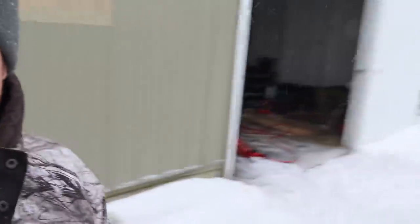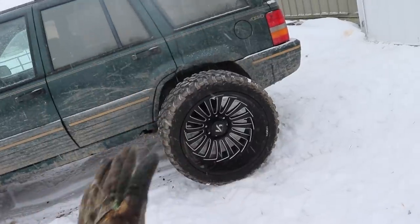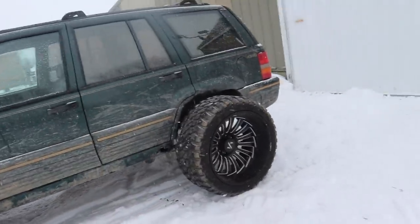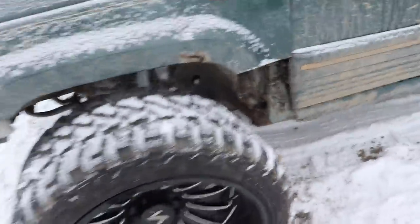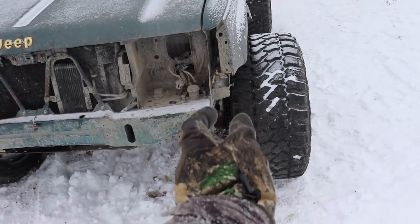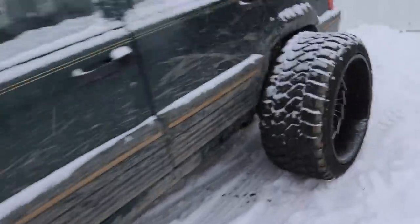We got the wheels and tires on this thing. The Jeep's not completely hidden from the house, but it's mostly hidden. I'm gonna see if I can take it for a little test drive. That big clunking sound in the back ended up being the lug nuts on the very last spacer holding on the 5 by 4.5 to 8 on 6.5 adapter — they were actually coming a little bit loose, giving that play in the wheel. Tightened them back up and stacked all the spacers back on one by one. I don't know how much clearance we're gonna get when we turn the wheel. This axle is actually pushed over towards the driver's side about two full inches — you can see how it's halfway sticking out here, and on the other side only one section of the tread is under the fender. Doesn't fit perfect, but it was 600 bucks — what do you expect?